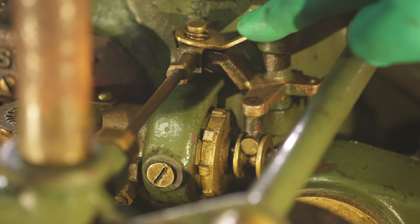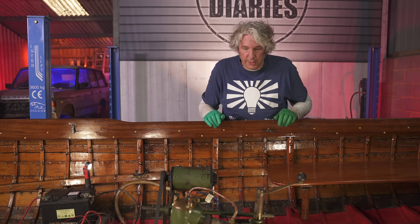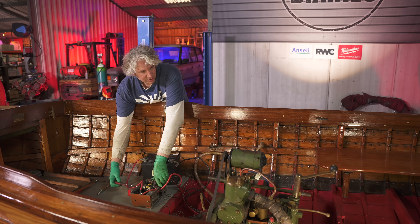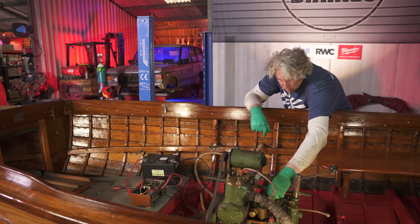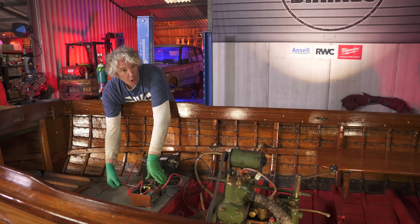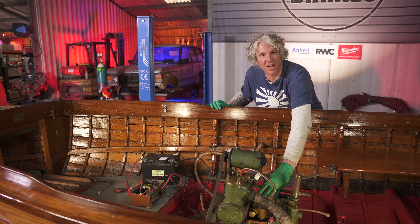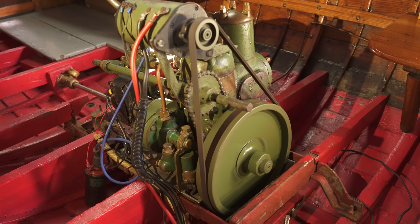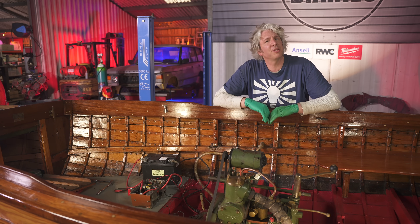So now I need to prime the carburettor just by tickling it — I'm just going to wobble this up and down and you can see a little bit of fuel is just coming out of this little tiny hole here. So we've flooded the carburettor there. Now the last thing I need to do is just adjust the idle speed cam — this little lever — all the way over, and basically that's just like putting your foot on the gas a little bit just to give a little extra bit of fuel into the engine. So here goes — we've got ignition, our little red light is on. Spin it over. There we go — that's brilliant! Well, I reckon that works nicely. Quite smoky, but it is a two-stroke. Listen to that — that is really rather lovely. So now the engine works, all I've got to do is get the boat in the water. But that is a job for another day.